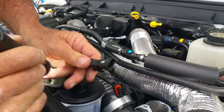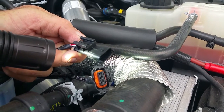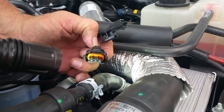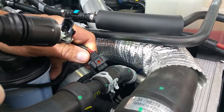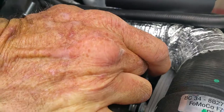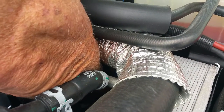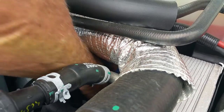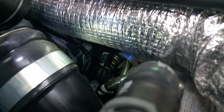So now we're going to take one portion of this. We're going to come in back behind the intercooler tube and plug into that sensor. Now the sensor has an arrow on it, so this arrow is going to go towards the locking cap. You can plug it in backwards — we're going to go over that. This portion here on the wire-to-wire — this has a prong. It's got two on top and the two on the bottom have been shaved, so this cannot be plugged in backwards. We'll plug this into the sensor first, down there. And then we'll plug the wire-to-wire in and go over how we can plug that in backwards if we're not careful. And there — I'm going to push until it clicks. There's a click. Let's get back down there and look at it. You can see the new wire is plugged in to the sensor right there.